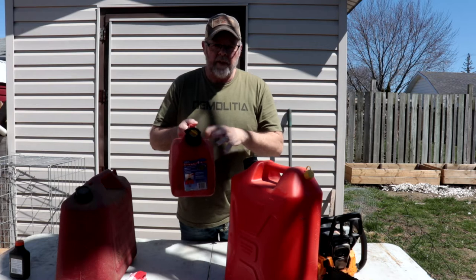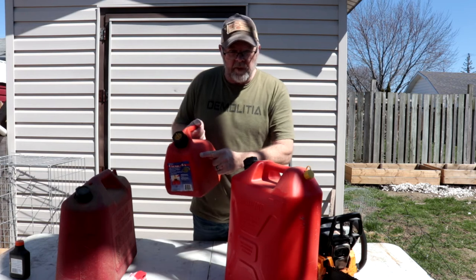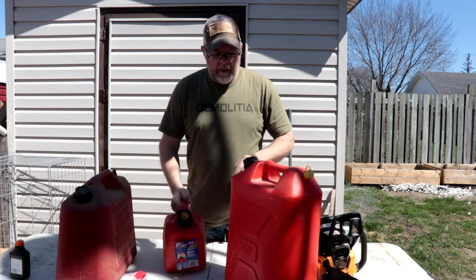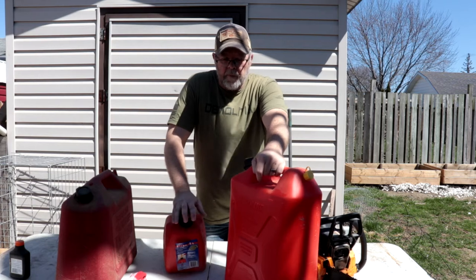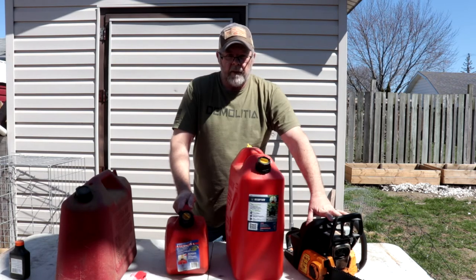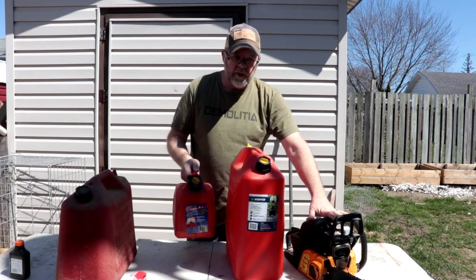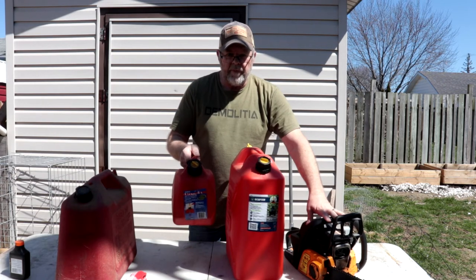Today I'm going to show you an easy way to do it. Most of us have a five-liter container — I'm in Canada so it's in liters. There's a top line at five liters; if you fill it past that line when you go to mix your oil in, it's going to overflow. The question is always: how much oil do I put in? With a five-liter container, we convert to milliliters: five liters is five thousand milliliters. You take five thousand and divide it by what your chainsaw calls for — chainsaw calls for 50:1 — so five thousand divided by fifty.